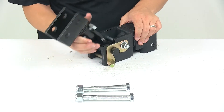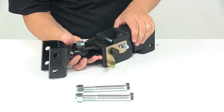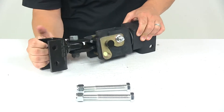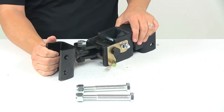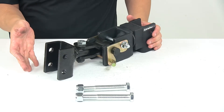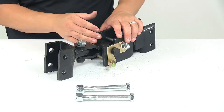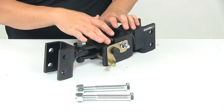When coupled, you have 360 degree rotation and three axes of movement at the connection point. This mechanism is designed to twist back and forth. Especially for off-road use, it really prevents twisting damage to the vehicle frame and the trailer frame caused by sudden changes in vehicle-trailer orientation. Instead of putting the stress on the frames, it's all in the swiveling joints.